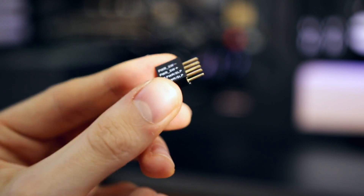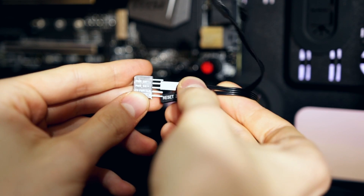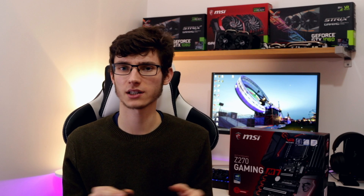There's only really been one serious problem I've come across that stops it hitting the Editor's Choice Award, and I have no idea why they do it — I think it's pretty stupid. On the board, the front panel connections are not done in the traditional way; they're split into two different blocks, and you use a block that you plug your front panel connections into and then plug into the board, but it's done in a non-standard layout. It means that if this breaks, you can't connect your case to your motherboard very easily at all. Sure enough, it broke literally the first time I disconnected the case when moving to a different case — which is quite frankly stupid, because now I need to ask MSI to send me another one. It will just cause people stress and misery if they decide to migrate their systems, and the pins were very, very flimsy. At least the way ASUS does it is a standard layout, so if it breaks you can just plug it straight into the motherboard as normal.